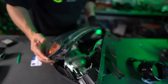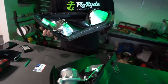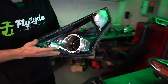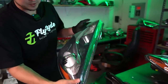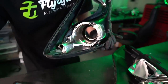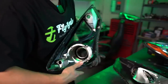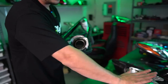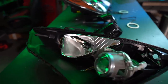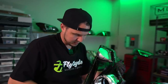Something I've said in lots of other videos is that this clear lens inside — there's just no good way to clean it. So I'm going to take some stuff out of here, but we have to protect this lens because if anything happens to it, you can't really clean it. I'm just going to take these internal parts out and then set the clear lens back on top so that it protects the projector and the chrome and all this stuff. You can't touch any of this stuff and you don't want to get dust on it either.